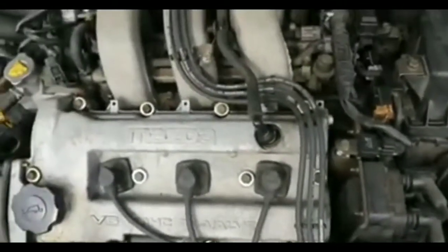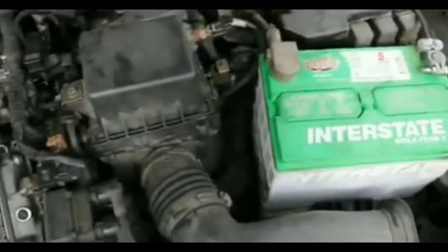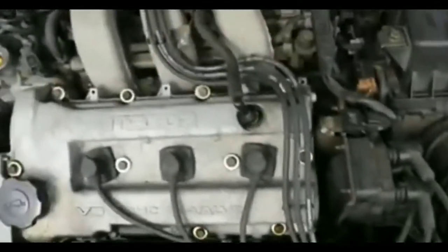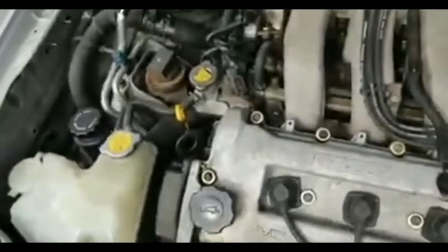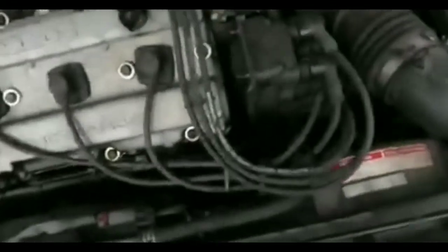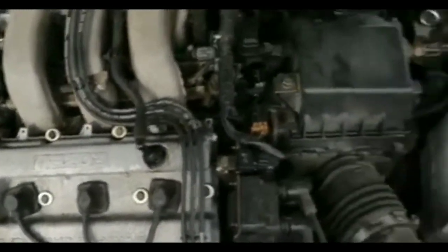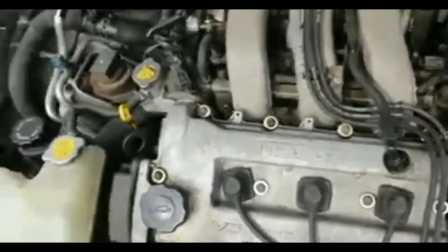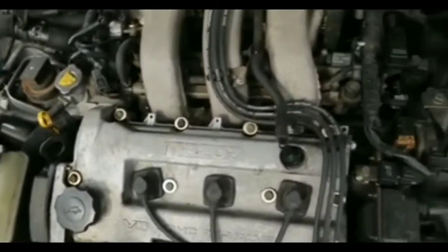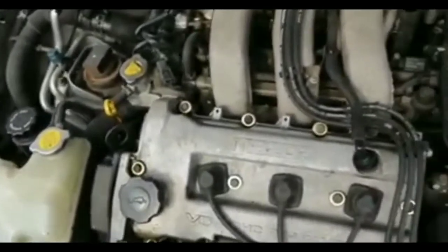The fuse. Could it be the fuse? So I'm thinking to myself, I don't have a fuse tester. I could get a fuse tester, but I'm not going to do that. The only 2 times I had a fuse issue where the car didn't start, one time the main fuse blew, and there was no electricity going to the car at all. Nothing turned on. No beeps, no lights, nothing. Swap out that fuse, the car turned back on, all the electricity turned back on. But unfortunately, that's not this case, because I am getting electricity into the car for everything except it's not starting.